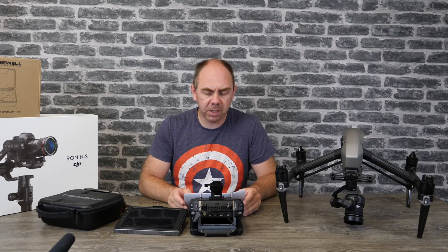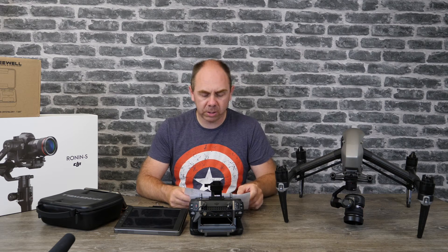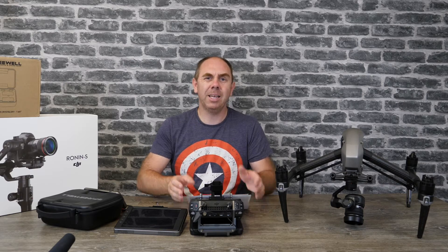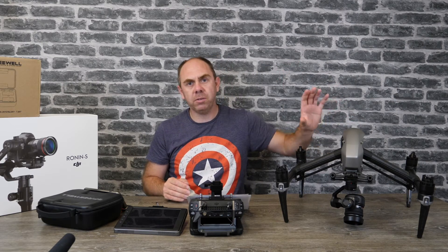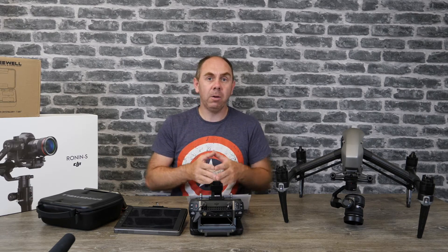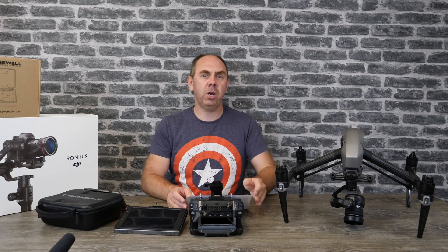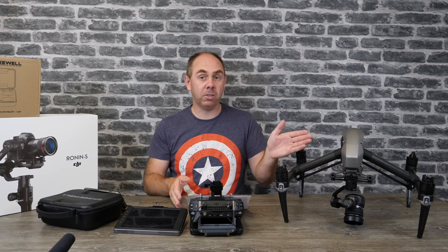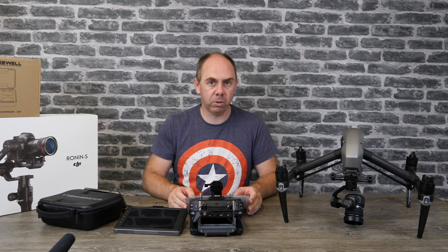Finally, on the firmware: if you're not going to update to version 1.2.0200 and are waiting as I've suggested, I would strongly suggest making sure you are on the last version, which was version 1.2.0100, because there are updates for your battery packs for the Inspire 2 that resolve an issue with cell errors. If you haven't updated to 0100 at the very least, do so. After updating, if you've had any issues with your battery packs, put them on the shelf for 90 hours and do not touch them — in that period the firmware does a balance on them, and if you have any packs with cells out of balance or incorrect cell errors, hopefully that will resolve it.